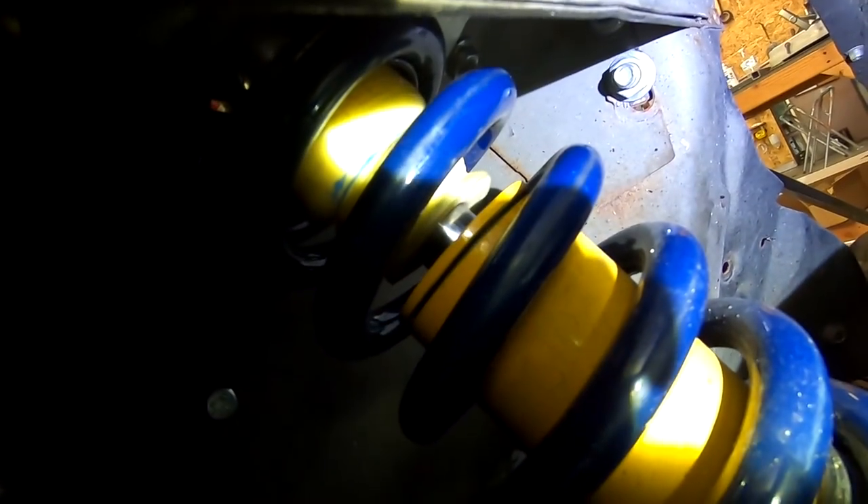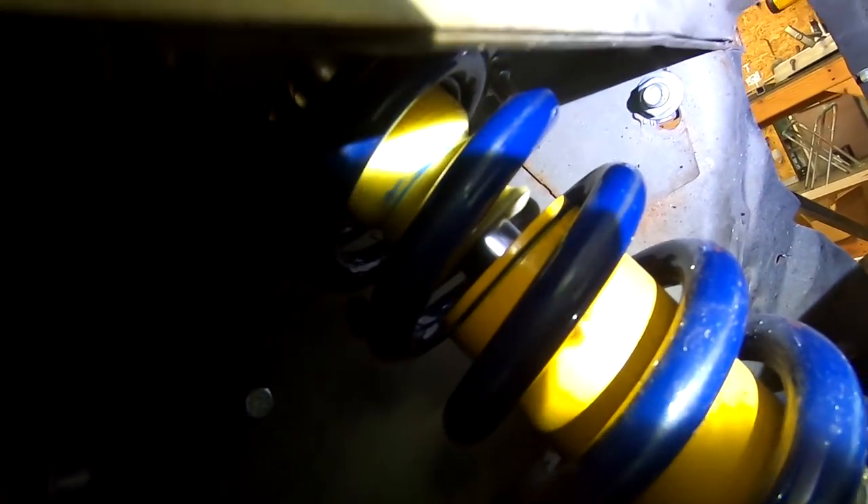The splitter rods — super happy with how they turned out. Last thing to check is the bump stops. I knew I was cutting it close with about a quarter inch of suspension travel. There's the bump stop and the top of the strut, and as you can see that's probably only about a quarter of an inch. So this is kind of new territory for us — thanks again to Will for letting me know I'm on the right track with the whole bump stop thing.